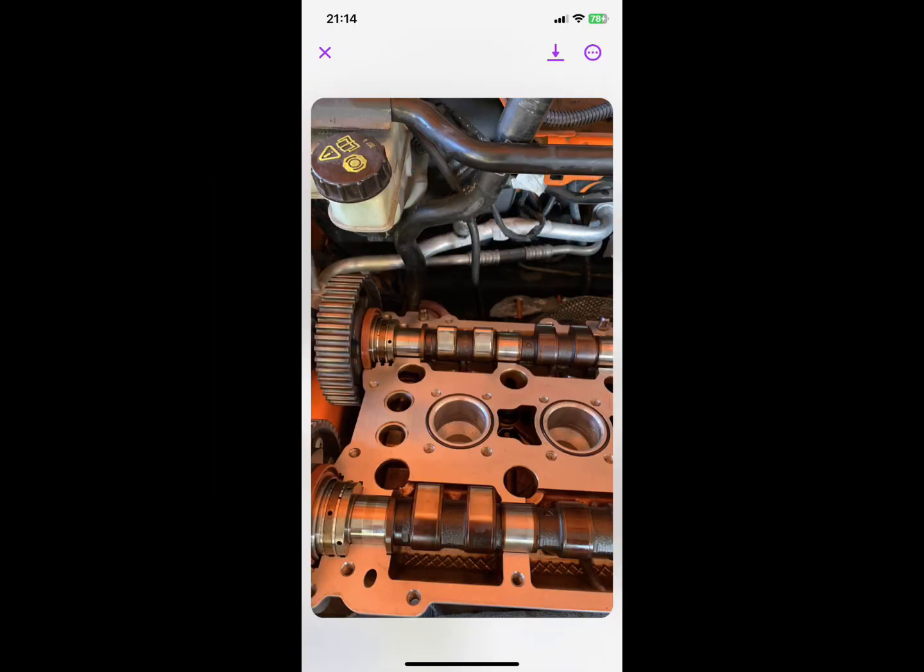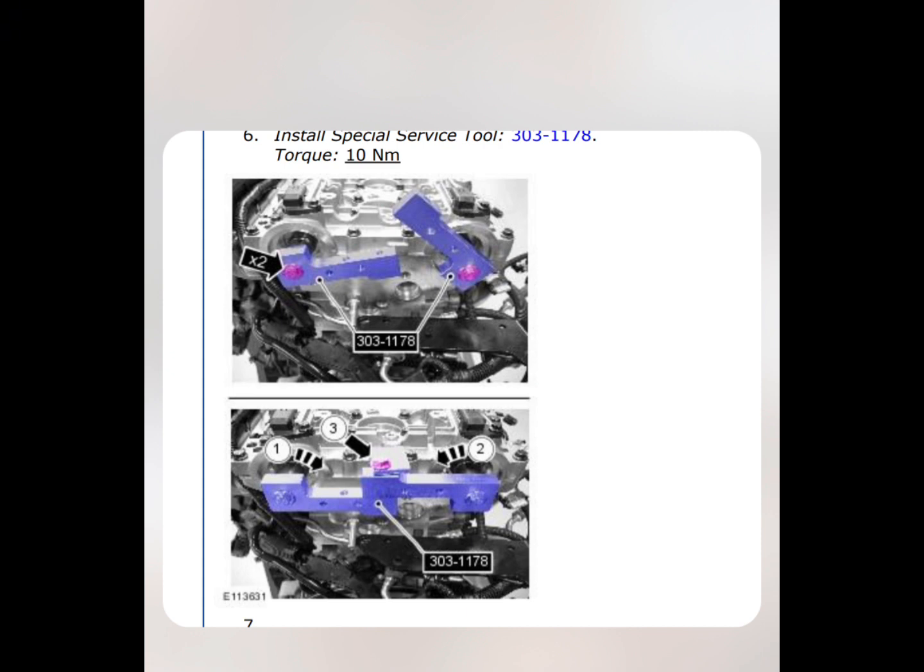Now you need to put your camshafts back into the cylinder head. Before you put your rocker cover back on, you need to replace these red camshaft oil seals. The actual Ford way to do this, I've linked in the description below. All I did was unlock my cams, slide the O-ring off the end, and then slide the new one on. This isn't the correct way to do it, but that's the way I did it, and I didn't have any issues. Now, you can place your rocker cover back onto the cylinder head.